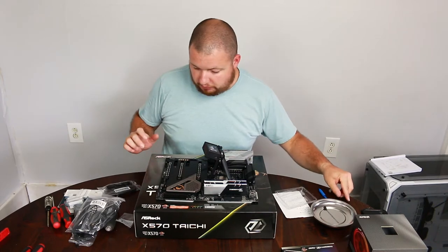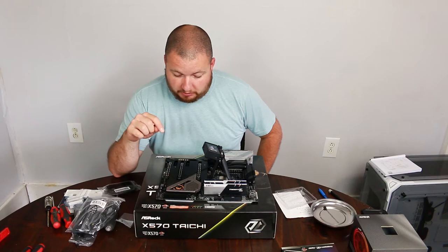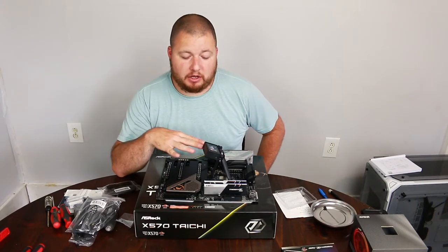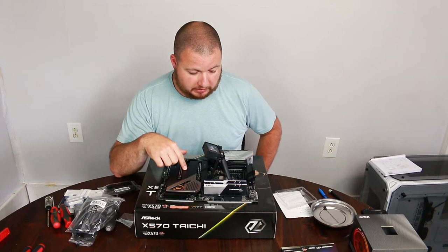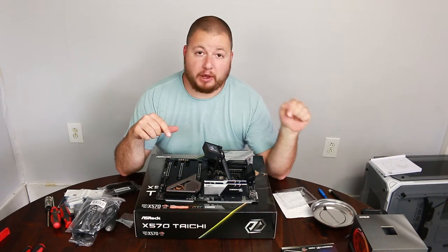Okay, so those are nice and put on. The reason we did it in this order is because if we put the heatsink on, that would have just gotten in the way. So CPU, RAM, and then our SSD. So now that we have most of the components done on the board, we can go ahead and put on